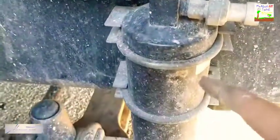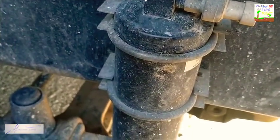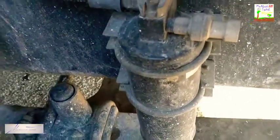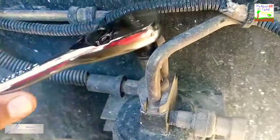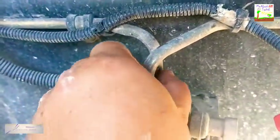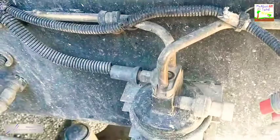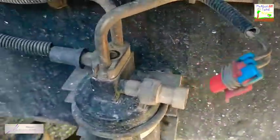We'll just go ahead and cut this in a little bit. You have four nuts holding the U-clamp or the bracket for the dryer. You'll need to remove those nuts — on this vehicle it's half-inch nuts. But before we do that, let's go ahead and open up the lines. We're doing this to make sure we won't have any bad or dirty chemicals going into our AC compressor.